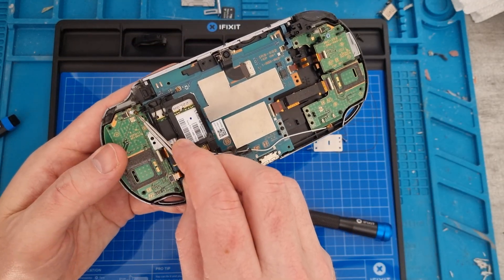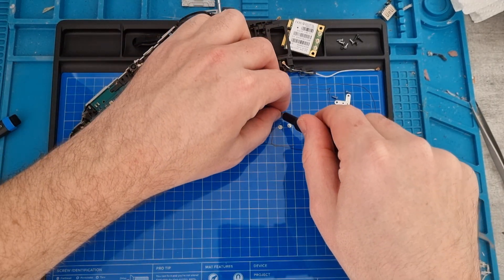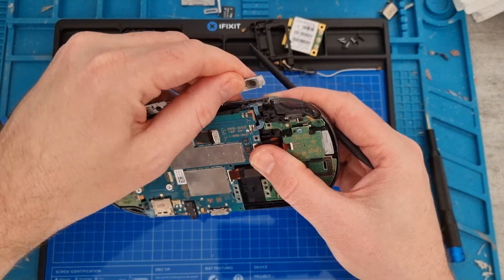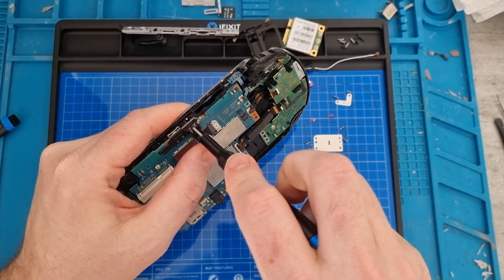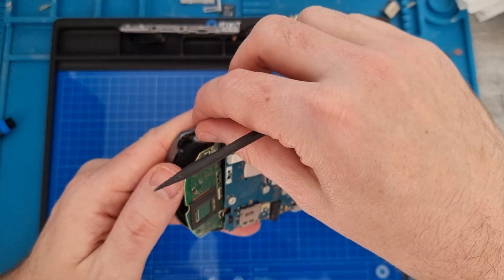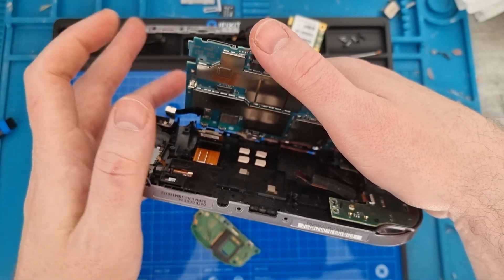We take out a few little cables and disconnect what we can. A plastic piece comes off — I think it's something to do with the Wi-Fi or 3G. We disconnect another ribbon cable and the top cover pops off, revealing a screw underneath. We disconnect the camera and remove the plastic piece behind it. Now the motherboard comes loose — it's attached at the back. I remove the side daughterboard as well, release its ribbon cable for better access, flip off the connector, and the motherboard comes out.